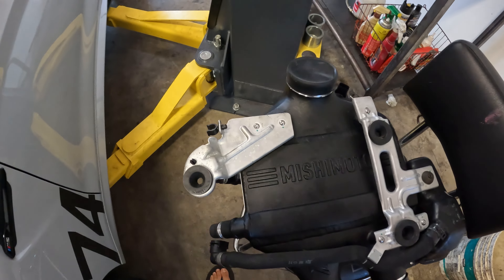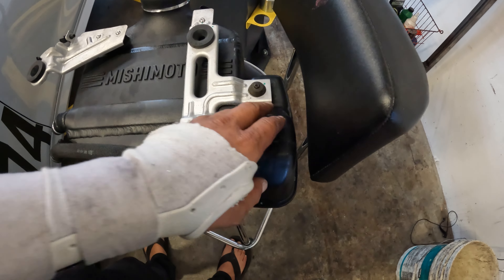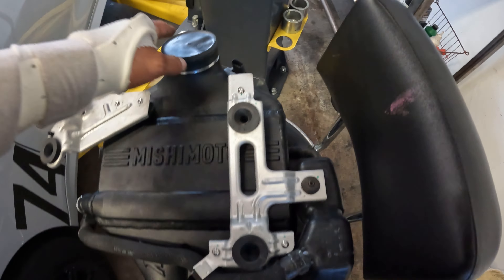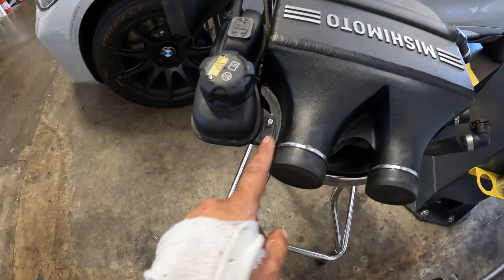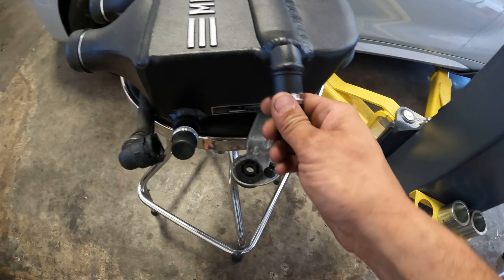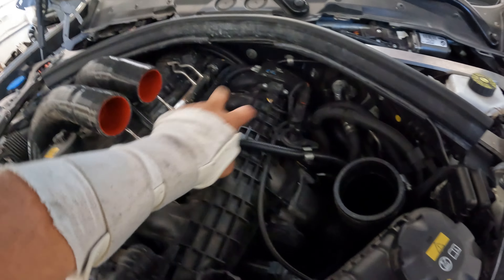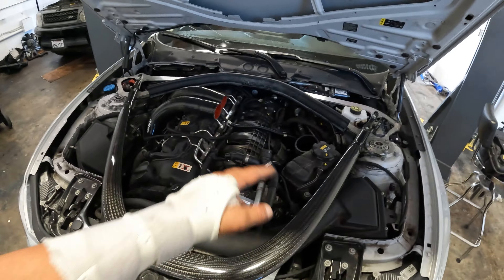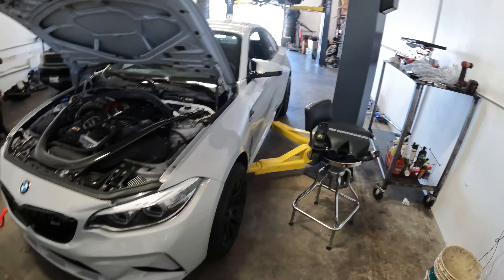From the bottom you've got two screws here to hold on the front bracket. Flip this thing over — it'll be facing the front with the rear bracket, reservoir with two screws, and two screws for the MAP sensor — looks just like our OEM one did with the reservoir mounted there. Everything's tightened down. Last thing is to pull the clamp forward, pull all these little caps off the ends, and it just plops down — registers on these two rear nipples and this front nipple goes into the J-pipe on the charge pipes, clips onto the coolant lines, and we're done.